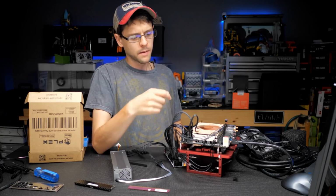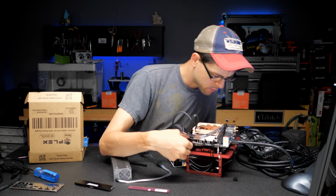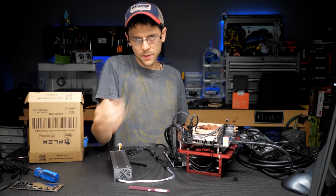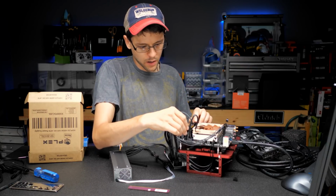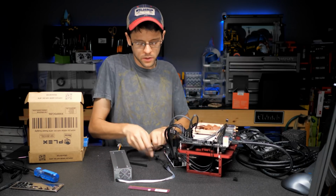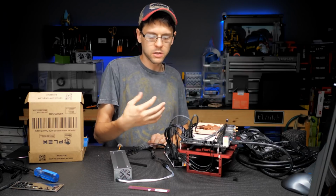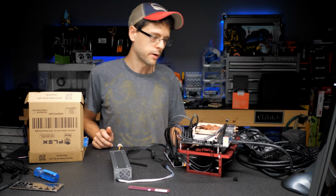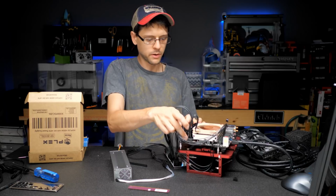This board's more of a budget board, JP. So I wasn't really expecting to have any diagnostics on it, but I would have expected the speaker to make a noise though. And the problem is if I put this other stick in here, it's probably going to post, but I'll have problems down the way, especially when I start using the APU. That was my problem with the last APU build I built. Same kind of deal. I had one stick of memory that was bad. I could install Windows on it. I could run most applications, but if I ran a 3D game, then it would bomb so bad Windows had a hard time starting ever again without doing really long repairs. Let's see if it posts at all.